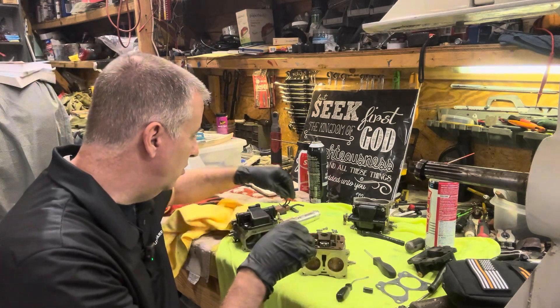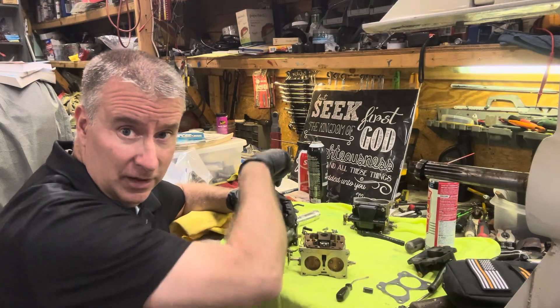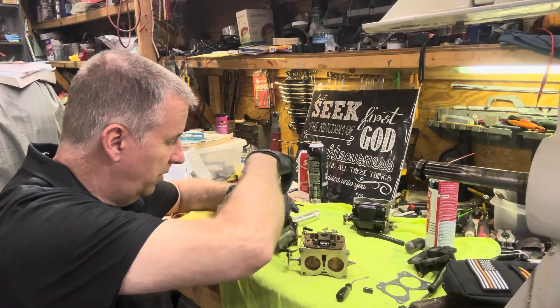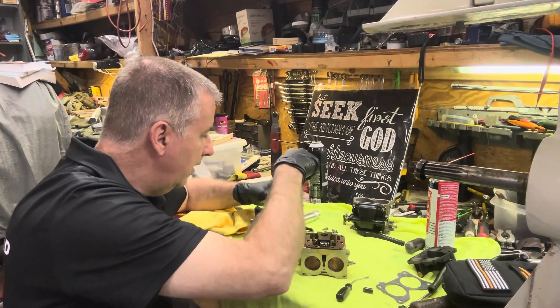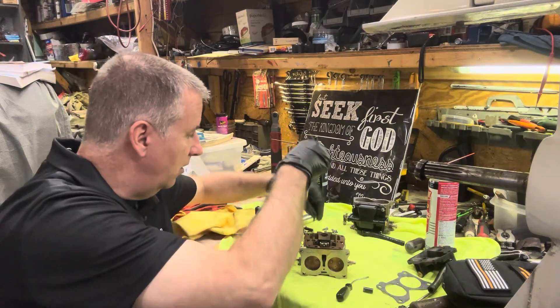Fortunately, I always say you can never have too many blown-up motors. I had an extra 88 Special out there with a carburetor on it, and these are not cracked. So I'm going to go ahead and remove the screws from this, clean this bowl out really good, and install it. But there's one more thing — the follower was also not good.